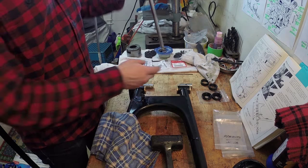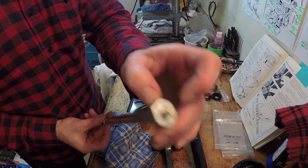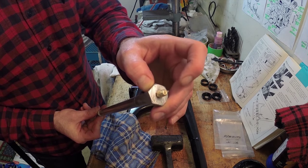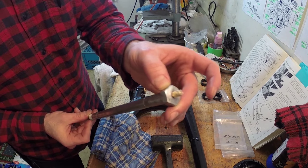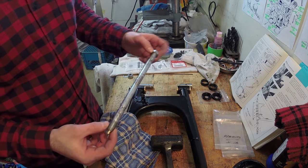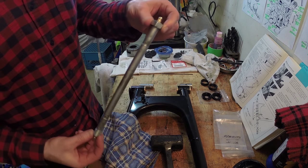I have my swing arm bolt ready to go. I've replaced the grease zerks — these are modern grease zerks. We drilled, really slowly drilled a hole and then tapped it with a 1mm M8 tap. These are M8 1mm brass zerks. I found these online for about 5 bucks on eBay. Brass just lasts longer. Same with the bushings here — they're brass. I've loctited these zerks in place with red loctite, so hopefully those aren't going anywhere.